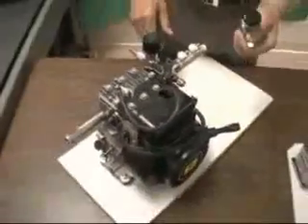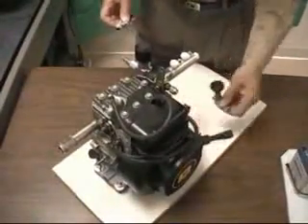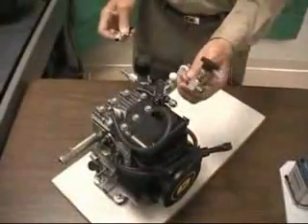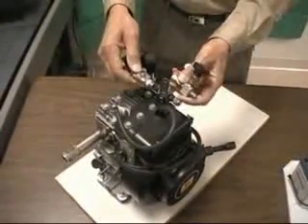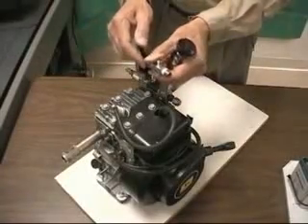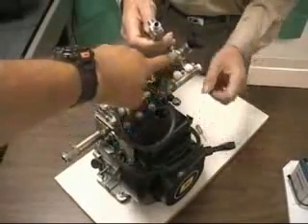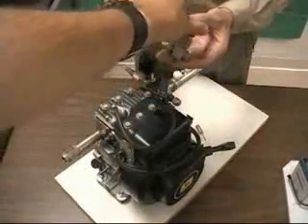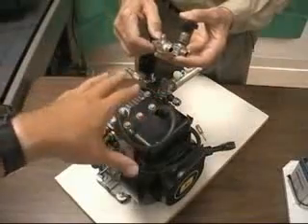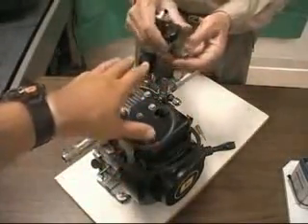What we're also showing is the ability to run this by setting up one valve as the idle valve, and then you can set up a valve in parallel that gives you the ability to put this on a remote foot feed. You'd set up the idle RPM at say a thousand RPM. We run hydrogen through this fine control needle valve — just enough to keep the engine spinning at idle.